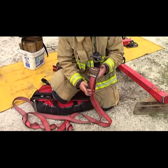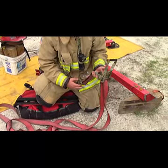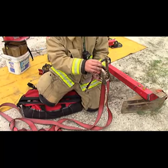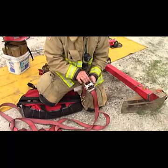When you're tightening up a ratchet strap, I like to tell people to go two clicks past snug. So when you start to see the load or the weight of the strut capture the load, just one more click, and then one more click after that — that should be all you need to lock it in and tighten it up. Two clicks past snug.